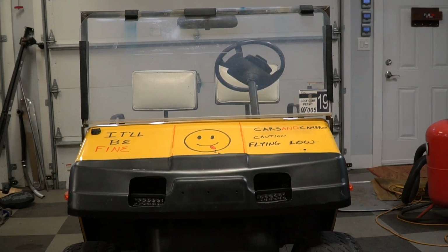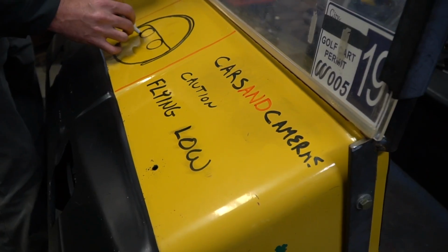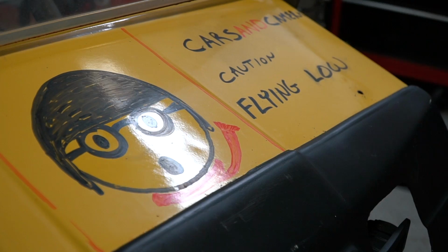We recently built a Stage 2 420cc engine, stuffed it in this golf cart, and then we made the golf cart street legal thanks to some recent changes in the town ordinance. Well, the top speed is 24 miles an hour, and we're limited to 20 miles an hour cruising around in town. This thing screams at 20 miles an hour. The engine RPM is high, the seat gets hot, and it vibrates a lot.